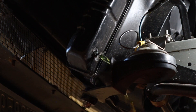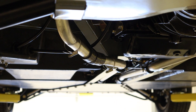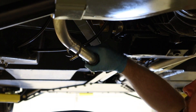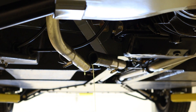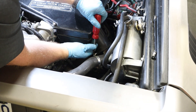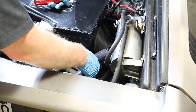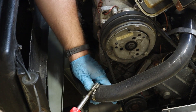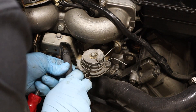I'm going to get the coolant draining from a few different spots — first up front at the radiator, and then the coolant pipes under the car. I just let these sit and drain for a while. Oh, here it comes. Oops. There's always another extra little squirt of fluid after a while and I don't know what that's from. Then at the back of the engine I'll pull the main cooling lines, and then the coolant bleed pipe that comes in from the water pump.